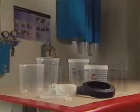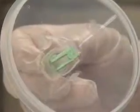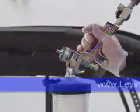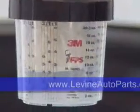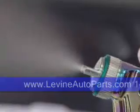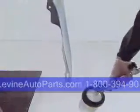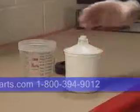The 3M paint preparation system is efficient. It uses just one cup for measuring, mixing, and spraying, and the built-in strainer allows the gun to run cleaner with less waste and mess. It's effective. It's a closed system. That means less outside contamination for cleaner jobs. And a closed system can deliver paint uniformly to the spray nozzle, allowing you to do excellent work at any angle. And it's economical. Mixed colors can be stored for later use.